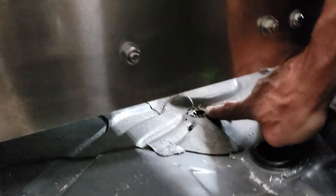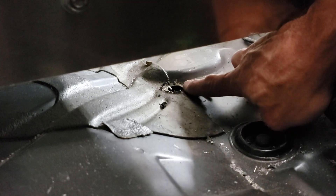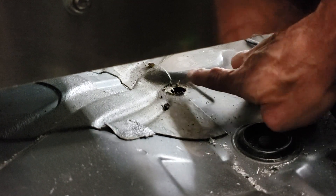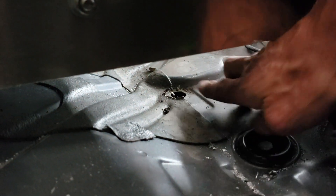The other thing you're going to do — see this plug right here? You have a big plug right here, and about six inches in you'll see this. There was a plastic plug here — that's your drain plug. You're going to pull that plug so that the water that comes in here drains right out over the gas tank.